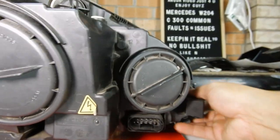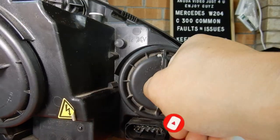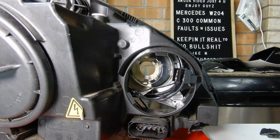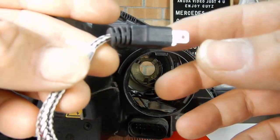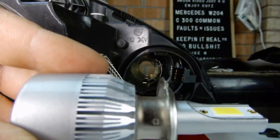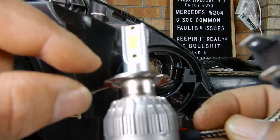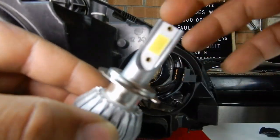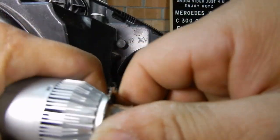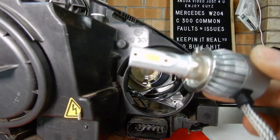I'm going to show you the high beams first, as I've already got a video on the low beams. Here are your high beams and your plug connector harness. To remove it, turn it counterclockwise and pull it out. Usually there's an H7 halogen bulb in here, but I use an LED light that costs around $15-$20 for a set from eBay or AliExpress. These lights come with the driver unit, but because of the total length you can't fit them as-is, so I pull the driver off, reverse it, and that way you get more room to install the LED bulb.